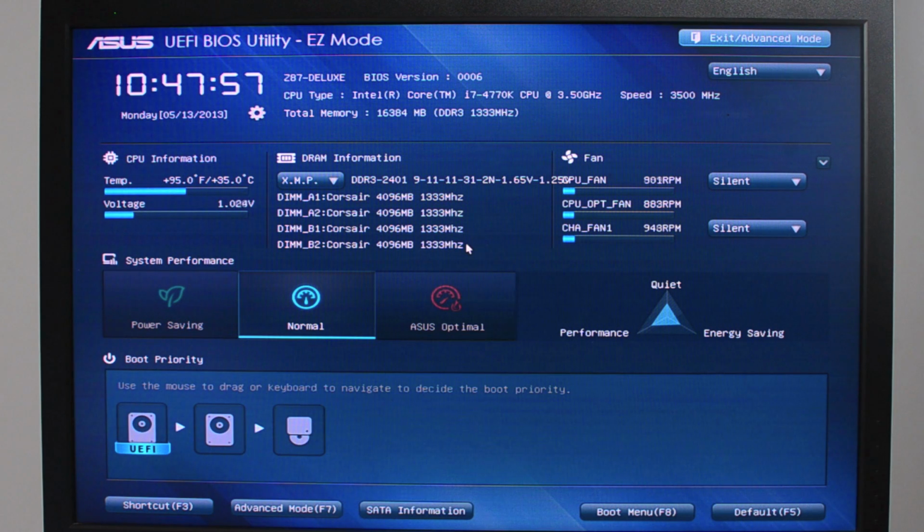So in the past, you'd have to go into advanced mode and then go into the overclocking section and then actually enable XMP. Yeah, it was probably close to maybe 4 to 5 steps to have to go in there to enable something as basic as this. And what we find is that there are a number of enthusiasts that might choose to run their system entirely from a stock perspective, and even though, quote unquote, they're running an overclocked DRAM profile, they're not necessarily interested in being aware of all those other aspects of the UEFI. So this just makes it easier for them.